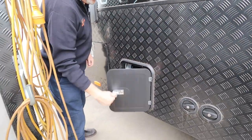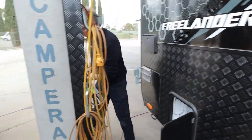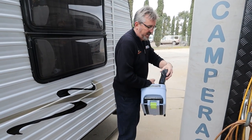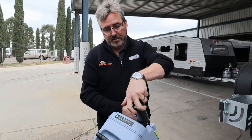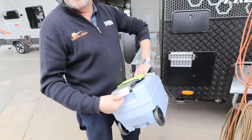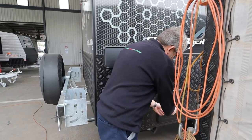This is the fun bit that nobody wants to talk about - your toot. A little green lever up brings your cassette out. To empty it, come round the post, unscrew that, push the little green button at the back here to release air, tip it out. That's all you'll do when it's not just water - into the black water, or into somebody's toilet at the caravan park. Screw it back up, get ready to slide it in. You do have a travel handle so you can drag it through the park if you need to. When it slides in, make sure you hear it go click. Use the chemicals to break everything down, otherwise you've got a bit of a mess in there.